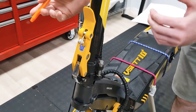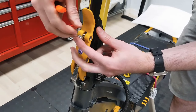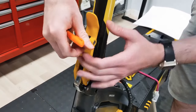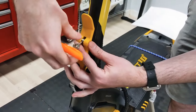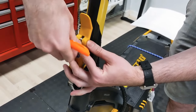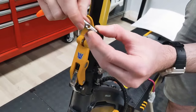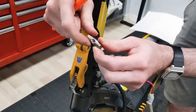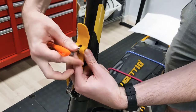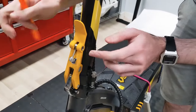Sometimes you may hear a rattling sound as well, and that can be caused by this little pass-through pin. Even though the screw is tight, this will still move back and forth. The easiest thing to do is remove this threaded screw, take it all the way out, take this pin out, put some grease around it — all the way around — stick it back in, and thread the screw back through.